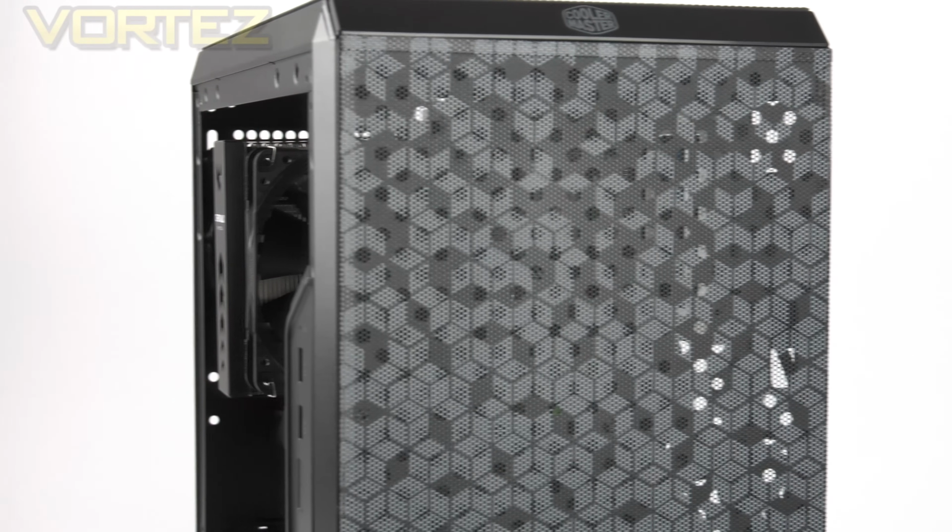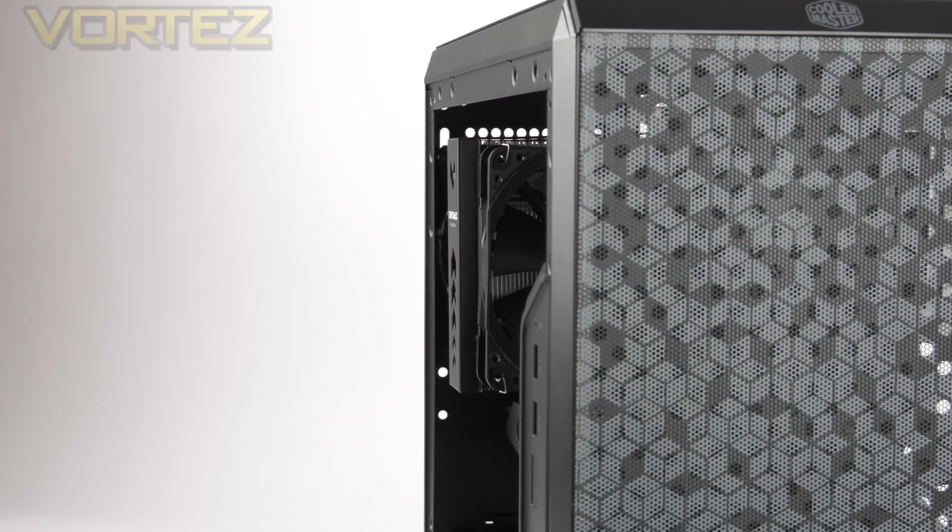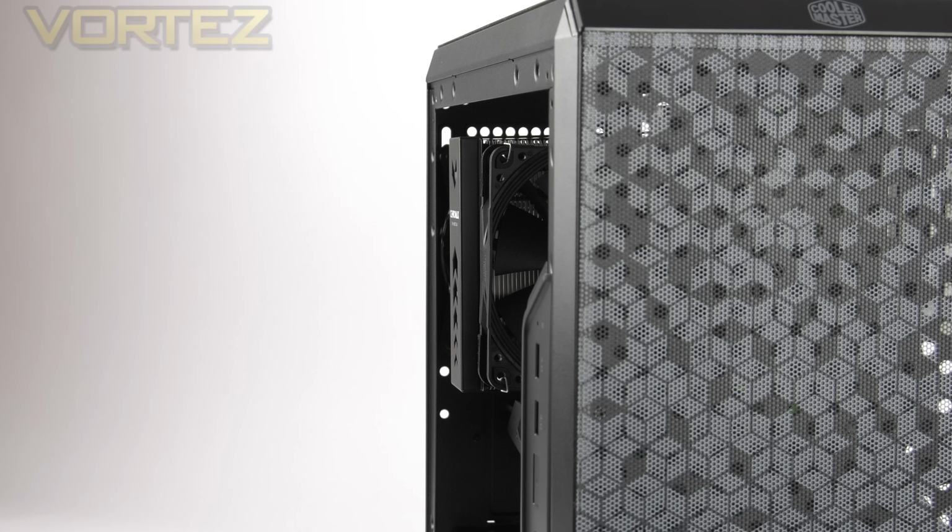CPU cooler clearance is a critical issue for size-restricted chassis, but Cooler Master has listed the Q300L as a relatively roomy 157mm. Here we have installed the tall Noctua NH-U12S complete with Chromax cover. At 160mm tall, this actually exceeds the 157mm clearance and just touches the side panel window. Although it technically fits, we in general would stick to Cooler Master's advisory.